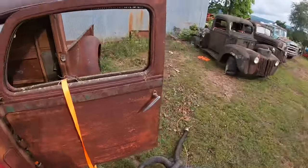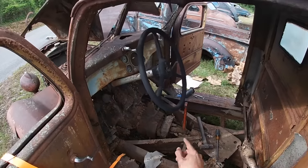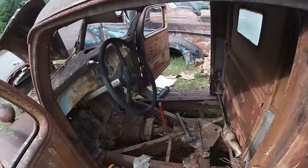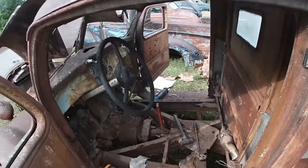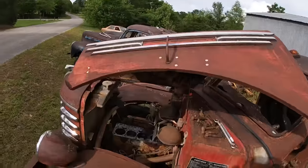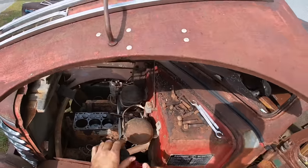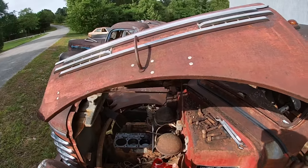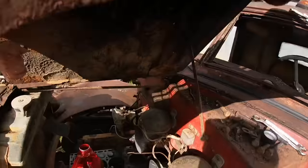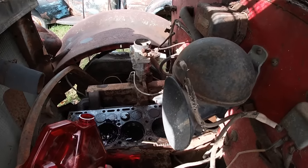About 30 minutes I've been messing with the transmission. I've got a pipe wrench on the drive shaft. I had to cut the old parking brake — emergency brake, whatever you want to call it — to get it loose because none of them bolts would come undone; they were stripping off and breaking off. Most of that Marvel Mystery Oil that was in the cylinders has soaked through. So I've got some more of it — going to pour these cylinders full again to keep lubricating down them cylinder walls, and we're going to try to turn it over here in a minute, if I can get a good bite on it with the pipe wrench.